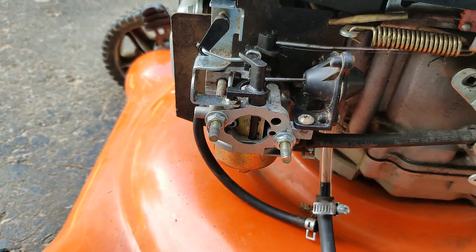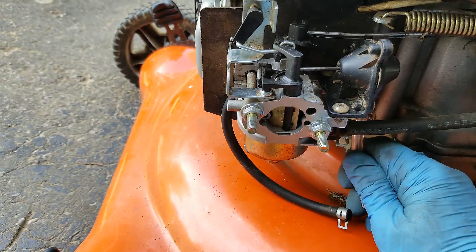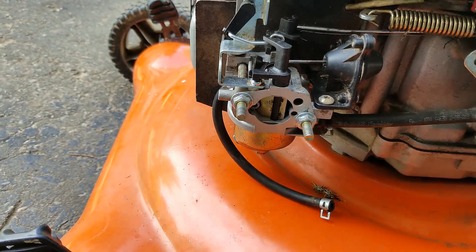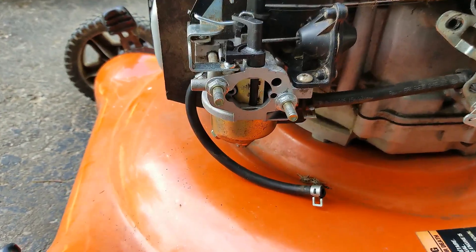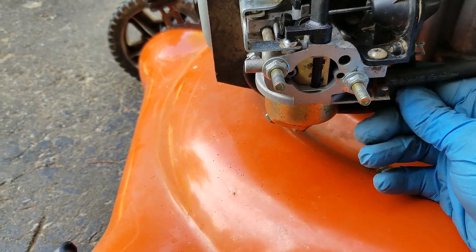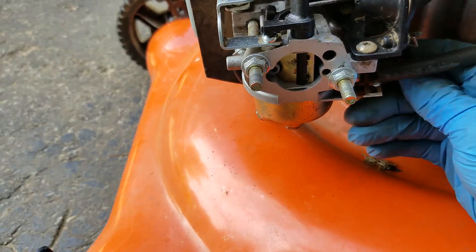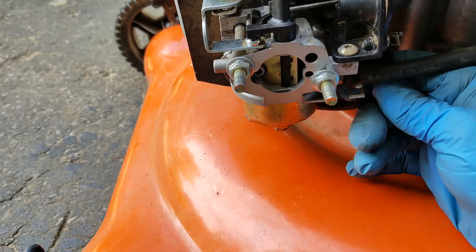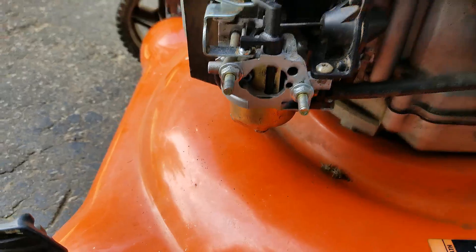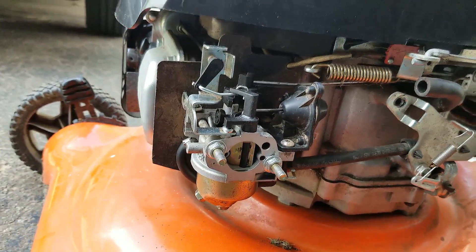So what I'm going to do is swap out this carburetor. But before I do that, I'm going to show you what this thing is doing right now. It's nice and cold, so it should fire up, but it's going to run rough and puff black smoke until it warms up. This will also show you exactly the two stages of how this system works. I'm going to increase the speed so you can kind of see the whole thing happen in real time.